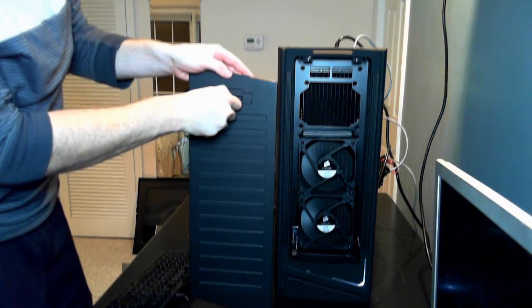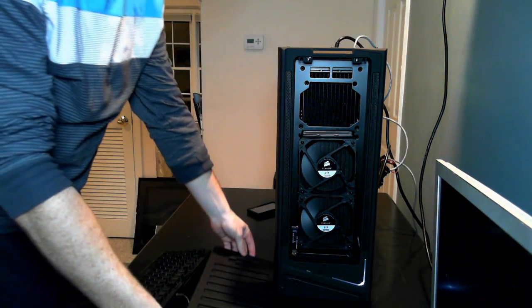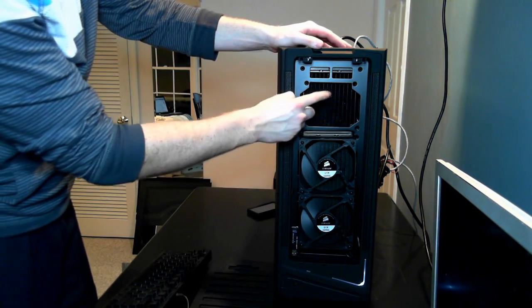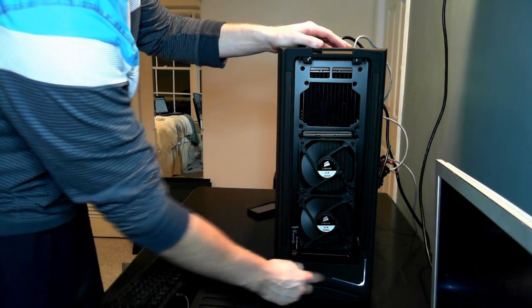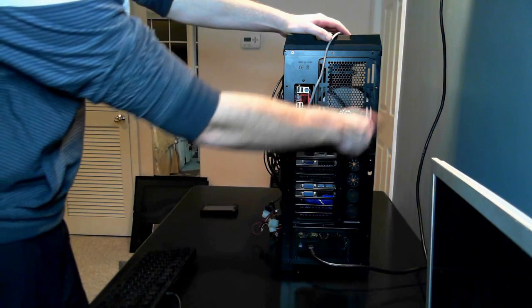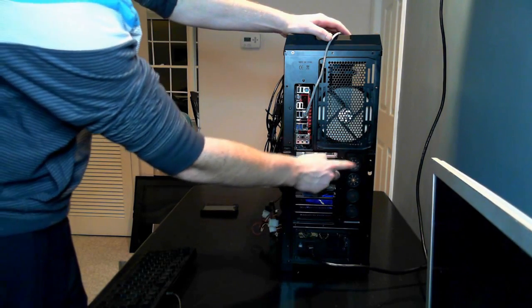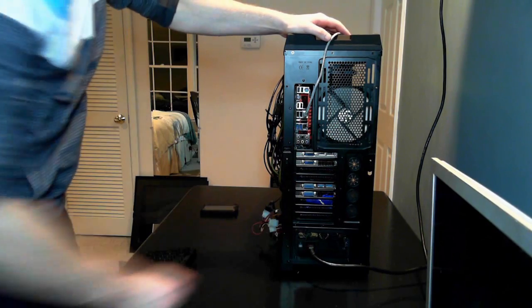The top of the Switch has a slide lock towards the back, which allows you to open and close vent slits for the top fans in order to lower the noise all those fans will put out. There is room for 3 140mm fans, one of which is already included. The power button is also located up top. The back of the case is fairly standard, containing a 140mm fan for outflow, 9 PCI expansion slots, 4 rubber grommets for water cooling management, and a cutout for the bottom-mounted PSU.